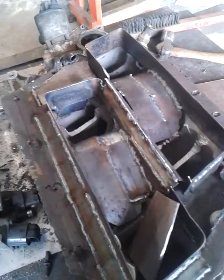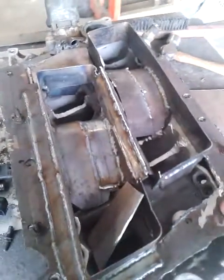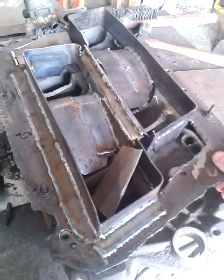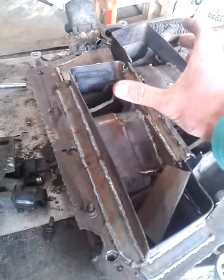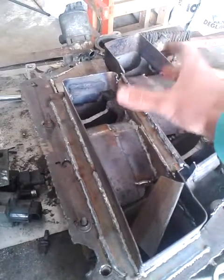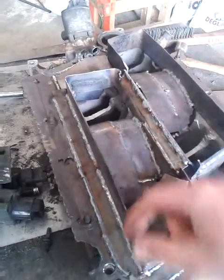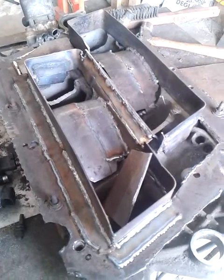If this doesn't work, I'll just buy the aftermarket intake. Since it's carbureted, you just have to buy a plate that adapts the square carbureted intake to a TBI, and you should be able to run that. There are guys already running something like that, so that's the fallback plan.